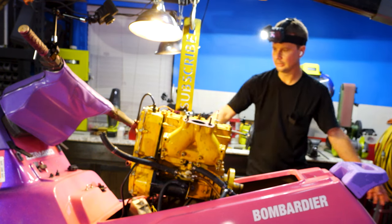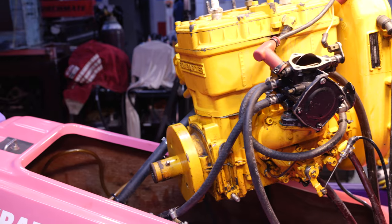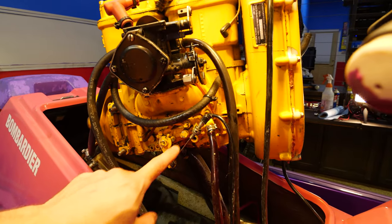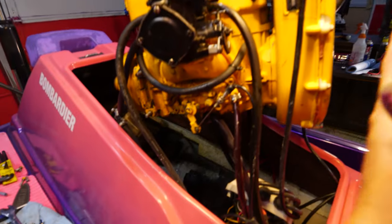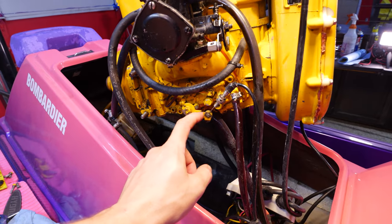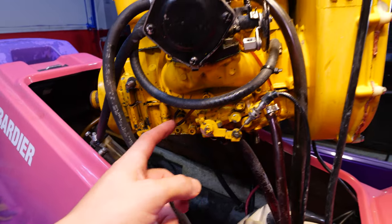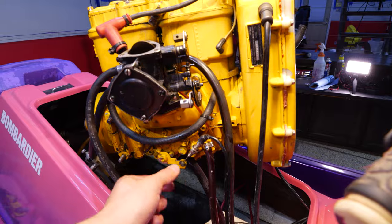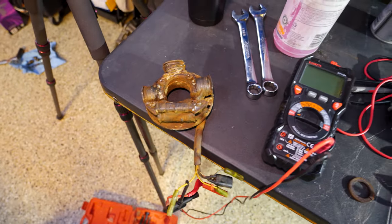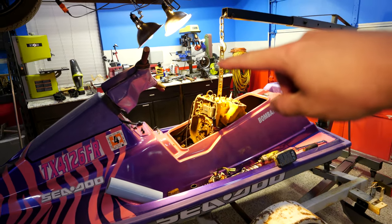Finally got the engine pulled out — it's been about an hour, hour and a half. It's a single carb. The main thing on these is the two-stroke oil pump — when you get on the throttle it moves the butterfly on the carb but also opens up this oil pump to push two-stroke oil through these itty-bitty tubes into each cylinder. I did test the old magneto again — no continuity through the charging coil, so it's truly shot. I've really only got 24 hours until we're headed up to the lake, so I've still got to get this engine back together, the jet pump sorted, and get on the road. It's about 11:30 at night — going to be one of those long nights.